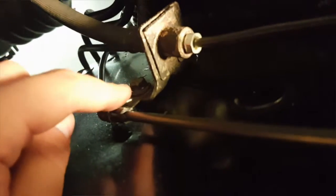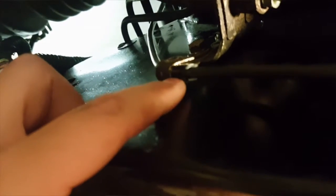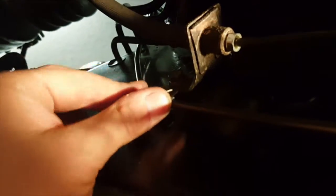This is normally supposed to be positioned on the passenger side. Just make sure when you use this clip you put some piece of plastic in between the line and this metal clip — I think it normally has a plastic covering but it was worn off. You don't really want metal on metal. I just got some plastic right here and ran it through to protect it.